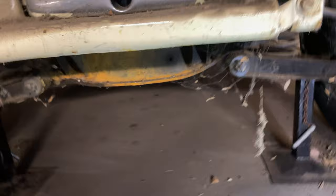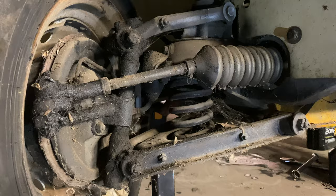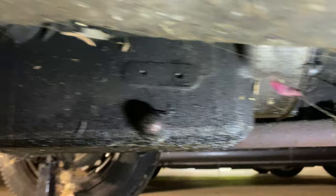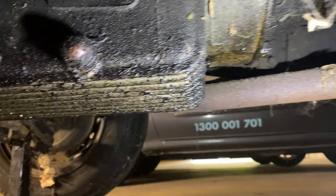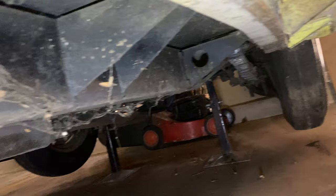We're going to start by looking underneath the car, which is easy now it's up on axle stands. We are first greeted by the coil spring suspension and rack and pinion steering, which was brought in on the TDs. Hopefully we'll be able to see underneath the engine. Underneath it's very solid, as you'd expect for an Australian car — most of them were exported to dry countries, so rust wasn't too much of a problem. At the back we've got standard leaf springs and the exhaust.